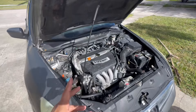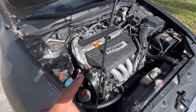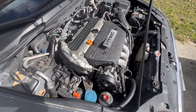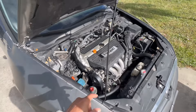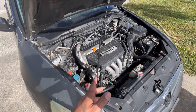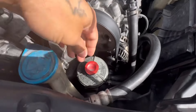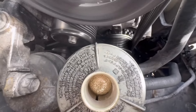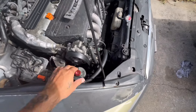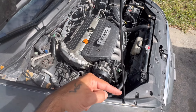So this is what it's going to sound like when your power steering O-ring is bad. Let me get the wheel turning. You hear that? That's your O-ring that is bad. So if your car is making that noise, most likely your O-ring is bad. Another key indicator is that you've got bubbles inside the reservoir — see all those bubbles? Those bubbles indicate air is getting into the system.